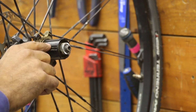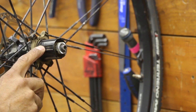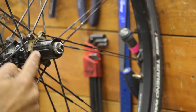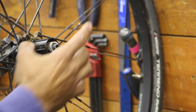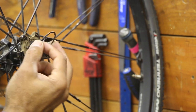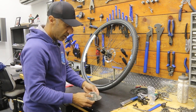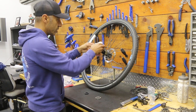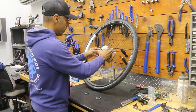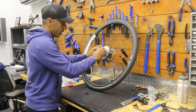I've got some writing on the hub — these are Crank Brothers wheels, a newer set, so they are adaptable and ready for 11 speed. But there's a real thin spacer down at the base of the hub. If you don't find it there, it's going to be at the bottom of your old cassette. Pulling that thin spacer off is what's going to allow me to jump to 11 speed. Now I'll go back and try again sliding the cassette back on — the number of loose gears can vary depending on the cassette.